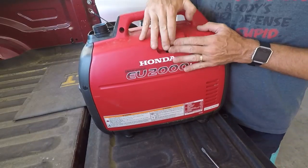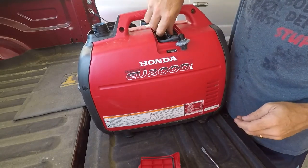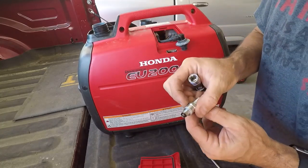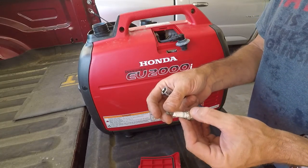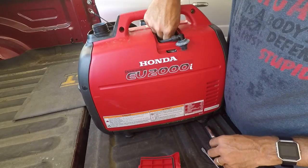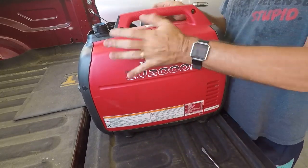Okay, so the first thing I'm going to do is, just since I'm doing it, let's check the spark plug. I've never had it out. One wouldn't think it would be dirty, but worth checking since we're here. Well, she looks barely used, which is what I would expect. A little NGK CR5HSB. Cute. So, we'll put that back where it goes. And that's not our problem.